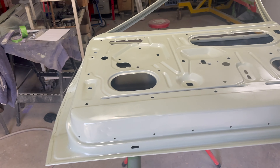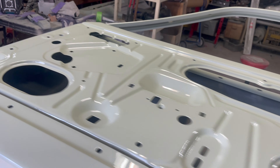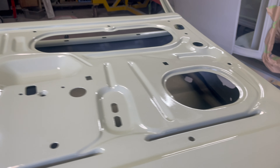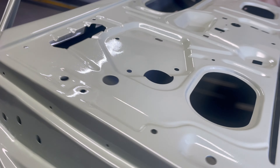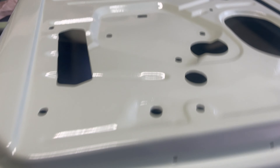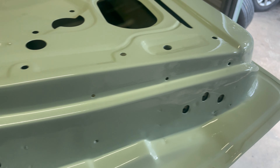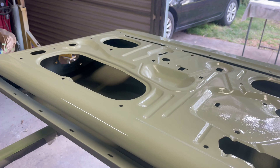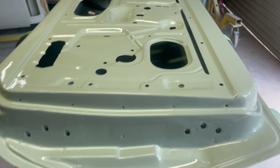I don't have an XY door — this is it. I've got the last coat of epoxy primer on it. It's a nice shiny coat this one. If you don't mix too much reducer in it goes nice and glassy, and if you get the gun set just right — takes a bit of fiddling. I wanted this to be a nice shiny coat so that it seals really well. Give it a scuff back — I'm happy with it. That's done.